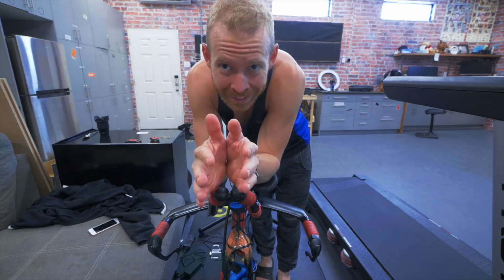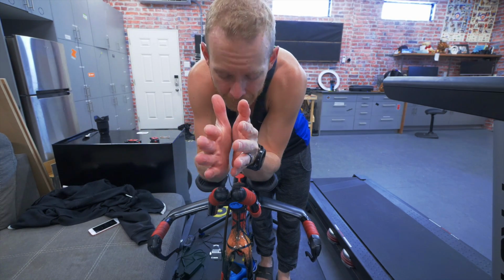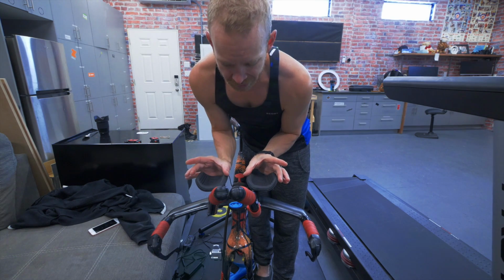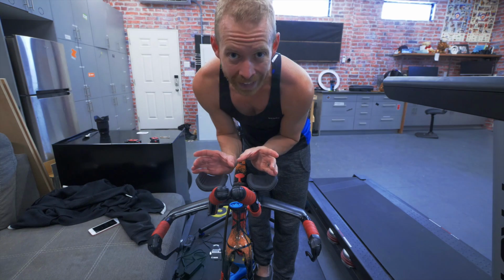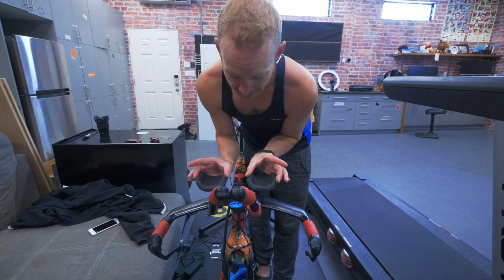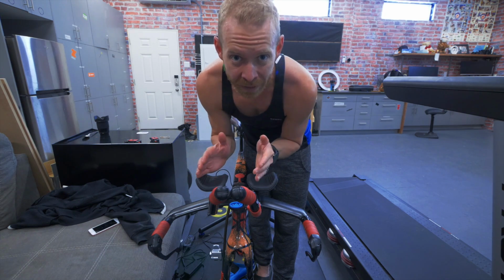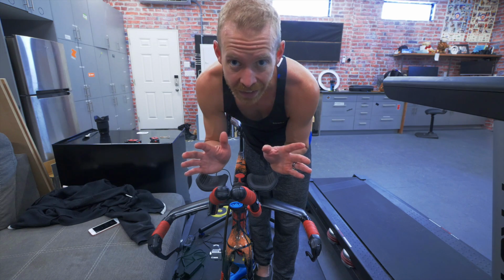The very first thing that I did to bring that frontal area a little bit narrower was I just moved the pads in 1 notch. So again, we're talking a 1/4 inch lower and about a total of a 1/2 inch tighter. That's it, nothing too serious.